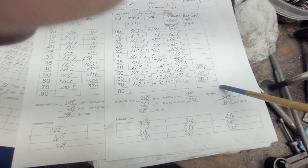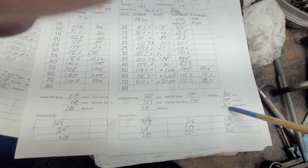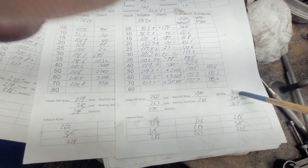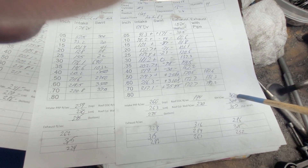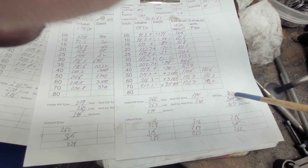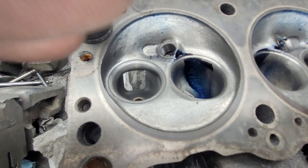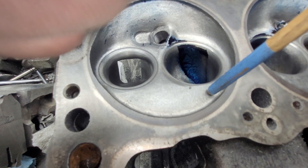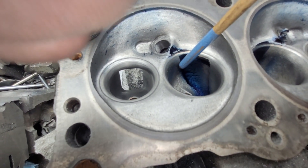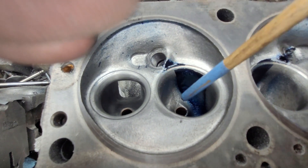Our entire short side has really got better speeds than we had before. They're quite even — 360 versus 357, very even. I think it's because the bowl is shifted over, it's actually easier to get air out from around the bowl and around the periphery of the valve from the center side. If you take a look at how the cylinder is designed — from here to here we're shrouded, but this side is all wide open. The more we can get out on this side the better.